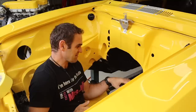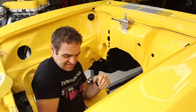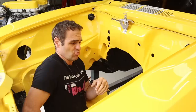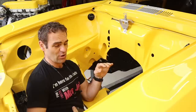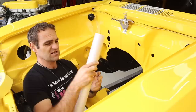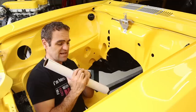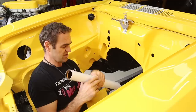That looks quite a bit better - just tidied it up and got rid of some of the overspray on the black area. It's not perfect and it's not going to be seen, but I just wanted to neaten it up before the next step, which is adding a bit more heat shielding. The exhaust headers I had to build are extremely tight - there is no room in here. So I went on to Raceworks and got a bunch of this gold heat shielding, which is a good reflective heat shield. I'm going to put it in the main areas where the exhaust gets really tight in the engine bay to give a bit of protection to the paintwork.